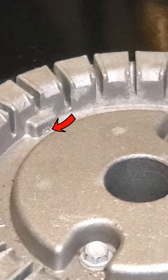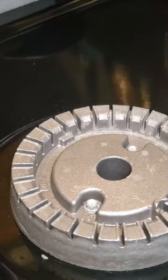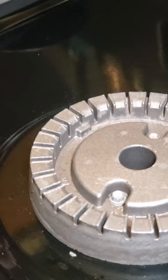What that little hole does is allow gas to escape and go through the hole to reach the igniter. The problem is that over time, food particles and cleaning supplies can gunk up that hole, preventing the gas from reaching the igniter.